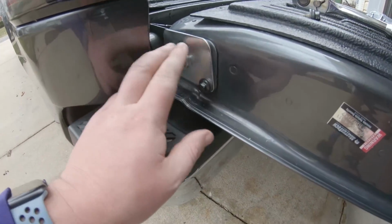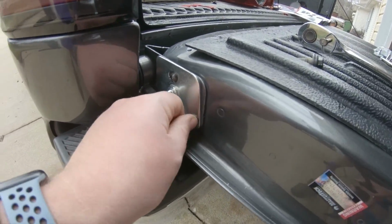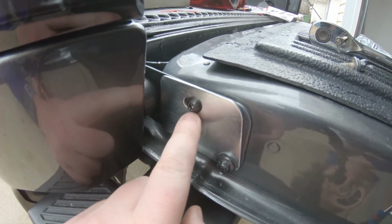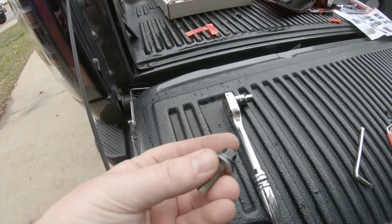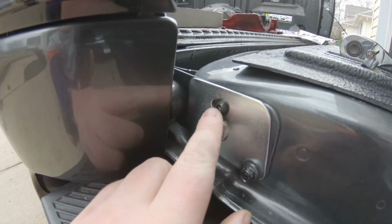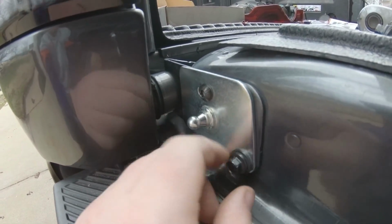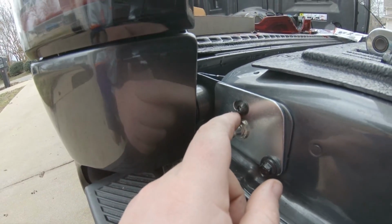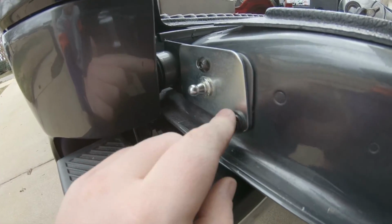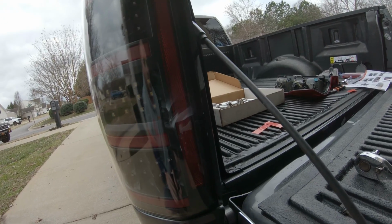So one thing to point out here, guys, is once this plate is installed, just make sure you go behind this bolt here, and then make sure you tighten it back down. I still need to do that. Notice here though, we have a 5mm hex bolt as opposed to this piece of hardware here. This is what originally came out. They want you to actually replace that with this 5mm hex. I'm assuming it's for clearance to get to this mounting point here, but either way, just something easy, and you should have the Allen key, so no big deal. And once again, remember to tighten this down. So I'm going to button this up real quick. We'll go up to the top, and then we shall keep going on here.